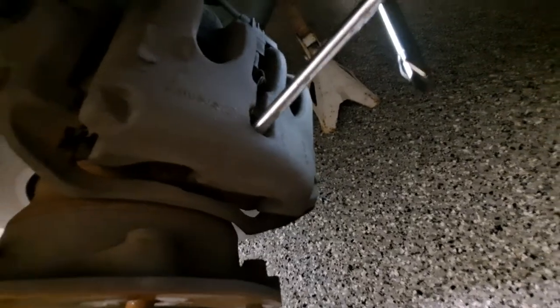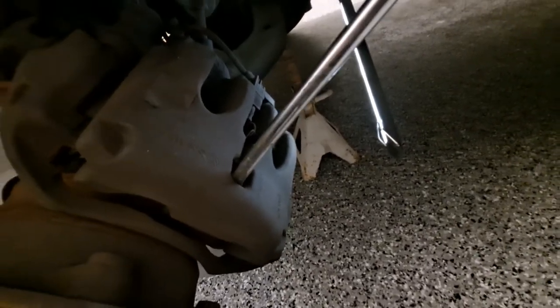On to the front brakes. Looking through, you can see the brake pads are shot and the wear sensor is probably wrecked. I'm going to use the hole near the lug nuts as my prying location. I land the screwdriver on the back side of the pad — not contacting the friction surface — and just gently pry. If the caliper's got an issue this really won't work, but if it's just that the brake pads are worn out, this shouldn't be that hard.